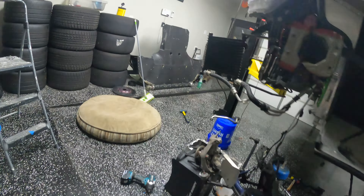One of the things that concerns me about this bearing is that, to me, it's indicative that something went through it. This isn't just wear — a little piece of debris went through the bearing. I've not pulled any of the others. It's such a pain to get access to anything with the motor in place. So I'm going to remove it entirely from the car and put it on an engine stand where I can get access. I want to pop them all off, look at everything, see what we're working with. And I want to open up the oil pump and take a look at that too.